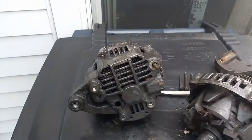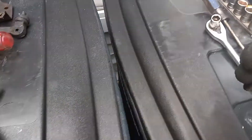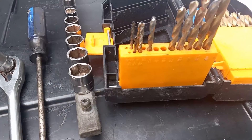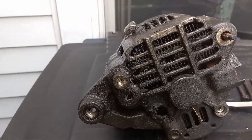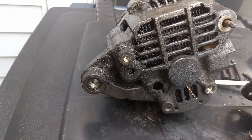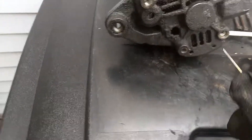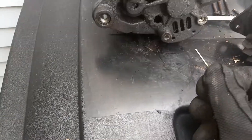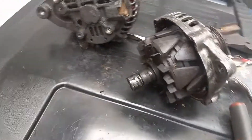One of the most important things if you decide to take yours apart and clean it — this drill bit right here is 1/16th inch. I've used a bunch of these for probes. On the back of the alternator there's a hole — you stick that in there, then press the brushes up into the side, push it in further, and it holds the brushes out of the way while you put the two halves of the alternator back together. This is also the same size drill bit you use to compress the hydraulic tensioner for the timing. Same exact one, so I keep a bunch on hand because I've snapped them before. It's the tiniest drill bit in my kit — that's how I remember which one it is. Alright, good luck.